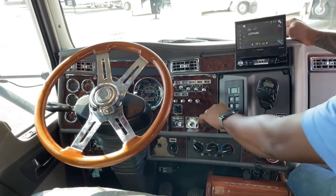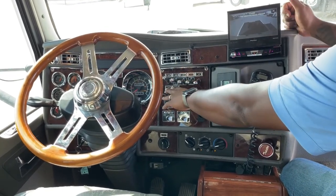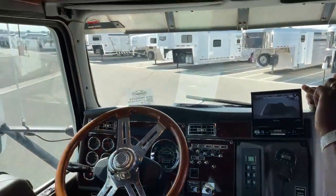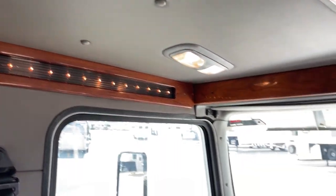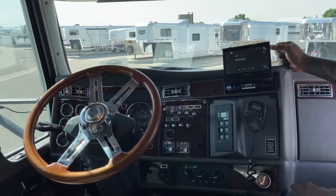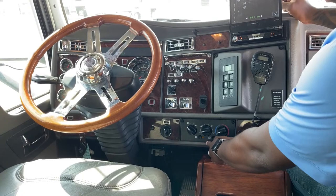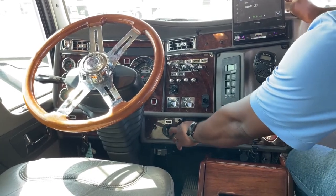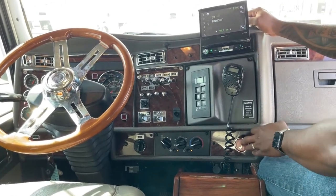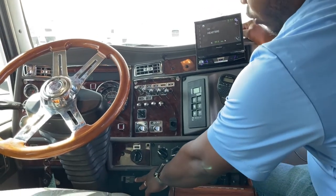You've got your fog light switch and a few spare switches — two of which are activated: one for the back cab lighting, one for the backup camera, and one for lighting inside the cab. We can label those switches for you so you know where everything is. You have the red differential lock and axle lock, all your AC controls, your wiper blades switch, the Allison 5-speed automatic transmission shifter, and this is your air parking brake — used to release or engage the air brake. Down here is your trailer brake system.